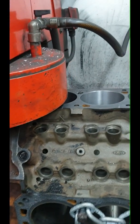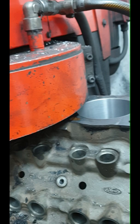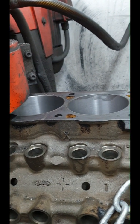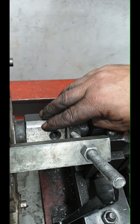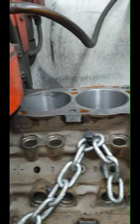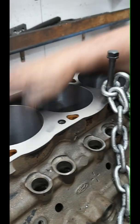All right, so we're done here now. The next step we've got is we're going to take a light cut off the surface on it, to make a nice area for the gasket to seal — especially this block, it's got a bit of a twist in it I've noticed. I'm going to get it flat. I've done my best to line it up with the crank, bolt it up — you can see there, that's the centre of the block — try to get it as dead level as we can. The next job, next step after this, is honing it — I'm not going to videotape it because you've seen it before, it's pretty boring. I'll clean it up and get it ready for assembly — and that'll be the next step to show you. I also have to relieve this block underneath, because it is a stroker engine — I'm going to cut a bit of the block and I'll get that ready for you, to show you where to cut and how to do it.